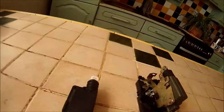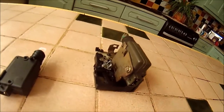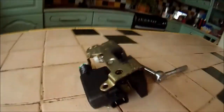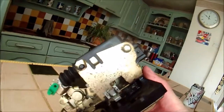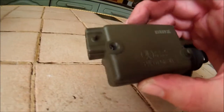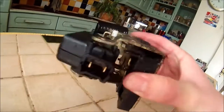First thing, there's a little 8mm bolt just to hold the module to the lock itself, so we'll just take that off. We've got the new part bolted on. Just one note — it's self-tapping, and you can see on the old one a little bit of swarf where it's been self-tapped. So you do have to push down as you're screwing it in to get the thread to go into the new part.